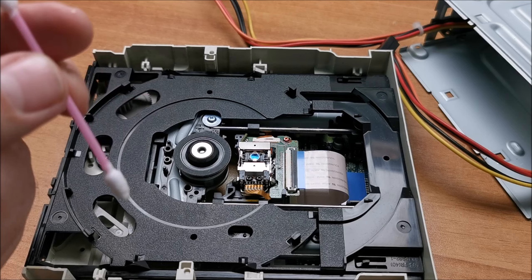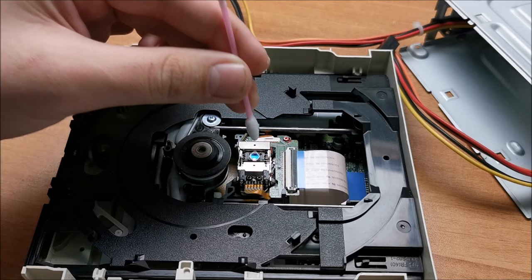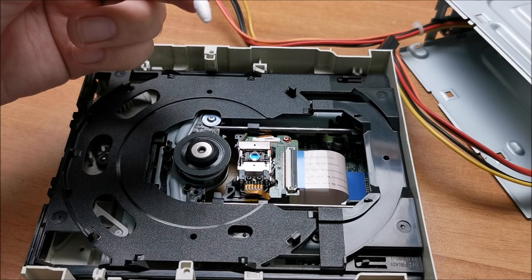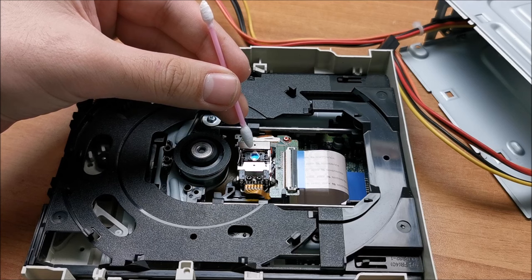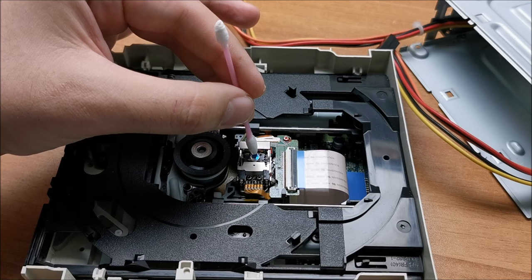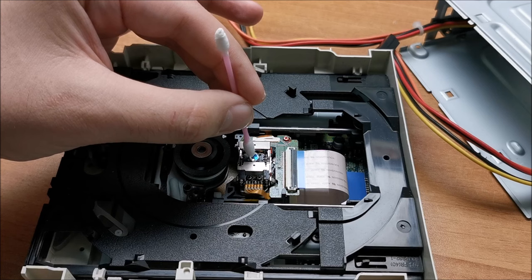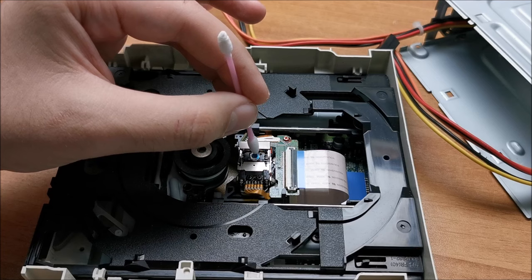We use one of these things — it needs to be new and clean. I don't use any type of alcohol or stuff like that, just this by itself. If your lens is really, really dirty, maybe use a weak alcohol, but there are a few types of coatings on the lens — you can see it has a bluish tint to it. Using alcohol, you risk damaging those coatings. What you need to do is make sure there's no dust on the lens itself. Do not press too hard — as you can see, it's moving quite freely in there. If you press too hard, you will damage something.